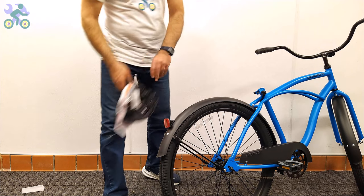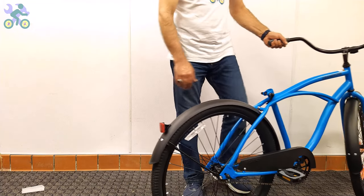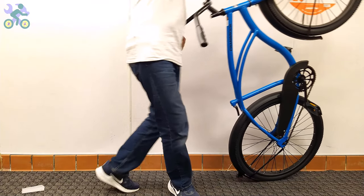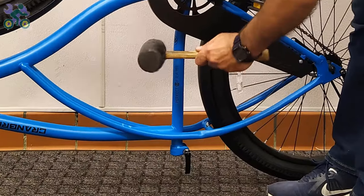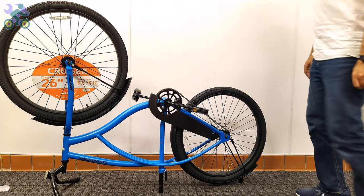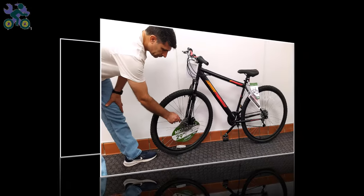Alternatively, one foot should be firmly on the ground while the heel of the other foot is flat on the pedal, or one foot should be on the ground while the toes on the other foot are placed on the pedal with the leg slightly bent. If for any reason the seat post falls into the seat tube, turn the bike upside down and gently tap the bike body to remove the seat post. Another solution to prevent the post from falling inside the seat tube is to install the seat post alone first and then attach the seat — this eliminates the possibility of the seat post falling into the pipe during installation.